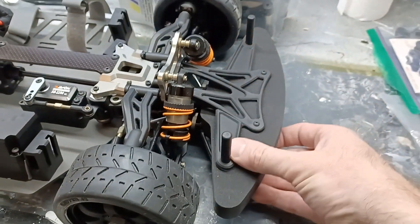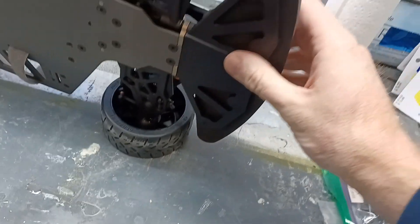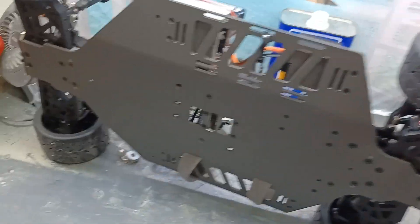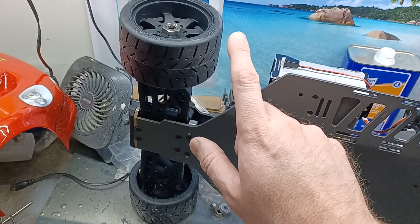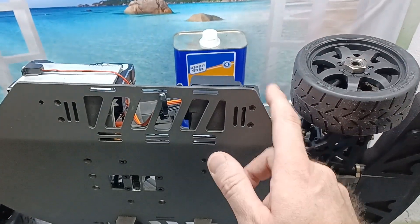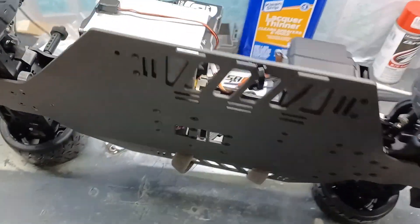One thing would be the front body mount system — it's just plastic, super flexible. Similarly on the bottom, making a splitter would be a little challenging; you'd have to attach it on the sides where it's raised, but it's angled so getting it flat would be a challenge. Getting a diffuser on the rear will also require creative designs. I don't know why everybody cuts the chassis like this — why not bring it straight up and straight across? You're leaving room here, and this huge opening in the back could be filled in. All these little openings are a bit excessive — if you want to reduce weight, carve it out on the top side where the battery sits.